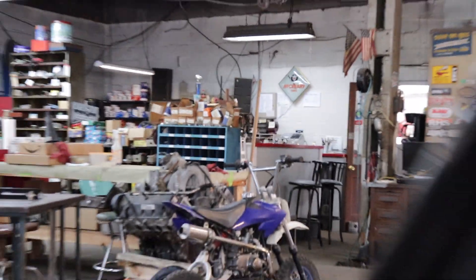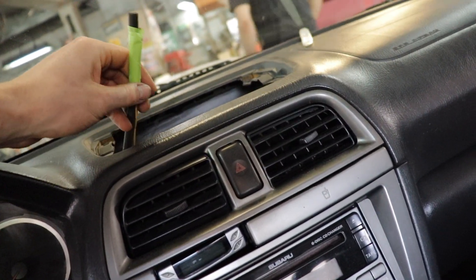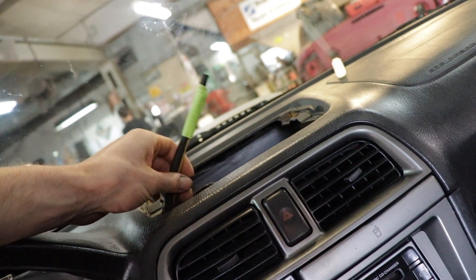We got Chippy J over there picking up the phone. I got the gauge out. I cut the boost reference line and I cut the wiring because it's mechanical, so all you use is the hose off of it to run the gauge. The rest of it's just for lights. So all I'm going to do is run the hose and the wiring from this up to the gauge pod to get the lights and power up there. What I'm going to do is take the boost reference line, tape these wires to it, and then stuff it up in there - then we'll have all our wiring up there. All right, got it fished up here with our wires and tape. One fell out but I was able to fish that up without too big of problems.